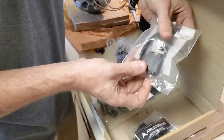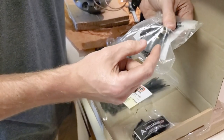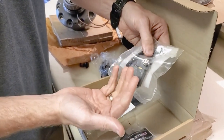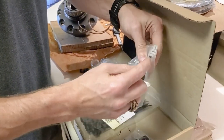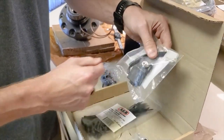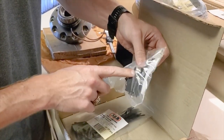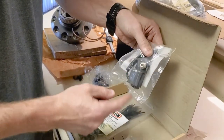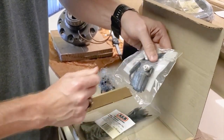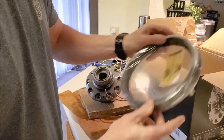This is a really cool piece — I have two of these, one for the front and one for the rear. It's an electromechanical solenoid and actuator. Air will be pumping into it from your pump at about 100 PSI, give or take, and then your switch that's in your dash — if you look at one of my previous videos, I've already installed these and showed you how to install custom switches in your Jeep JT or JL. Once you get the switch, you'll hear the pump come on and vibrate, and then you'll hear a click. This opens up and sends air down the line, down this nylon line.